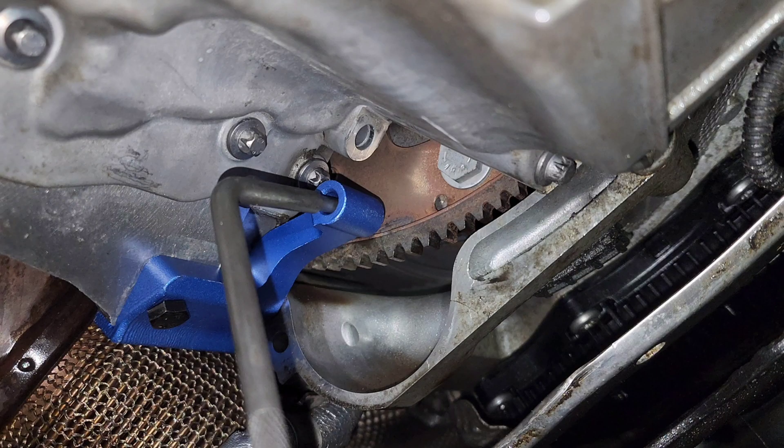Lastly, someone reminded me that this flywheel method for locking the crank only works for OEM automatic HP50 transmissions. If you have an HP70 swap, that means you have an N57 flywheel, and that flywheel does not have the hole needed to lock the cam positions in reference to the crank — you can't do it the same way. So if you have an HP70 swap, your best bet is to get a gauge where you can measure the height of the piston as it approaches top dead center, and use that point as a reference to lock the cams in position.